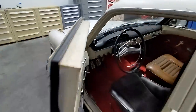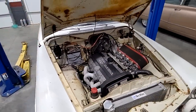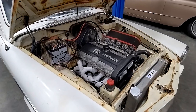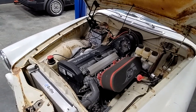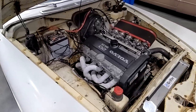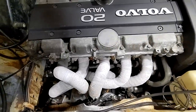We're a really good specialist on what's under the hood, so let's take a look. What you got here is your bone stock, normal, unmodified Volvo 850 engine. This would have come in anywhere from '93 to '97 850s, or it would have been in a '98, '99, 2000 Volvo S70. The distinction is that in '99 they went to variable valve timing, and this car has fixed cams. The car does have a header on it — the factory exhaust manifold won't fit because this was originally a front-wheel drive application. I made this header myself. It's okay; I kind of want to redo it. There are some things about it I'm not happy with, but it looks pretty baller.